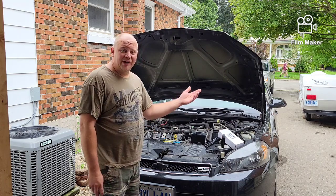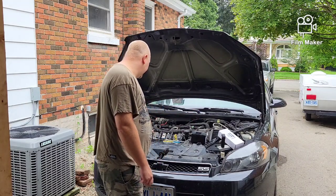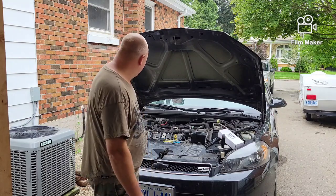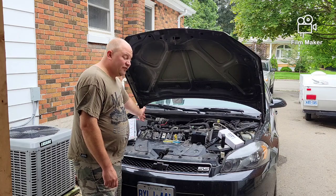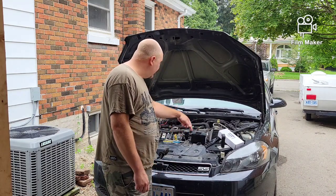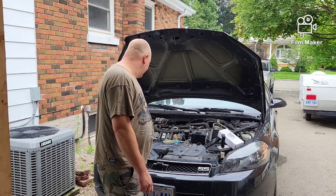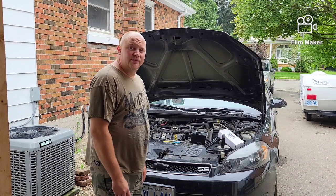Right now I don't really have a plan. I'm going to go grab an 8mm and a 10mm with my screw gun and start pulling stuff off - pretty much everything on top. We've got the coil packs, valve covers, intake manifold. Pretty much everything I need out of the way in order to start getting to the heads. The only other thing is going to be the alternator - just a couple of 15mm bolts and a couple of more difficult nuts to get down on the front between the engine and the strut tower. They make them pretty tight. After that it's quite simple - exhaust crossover, and then the manifolds have to come off to get to the head bolts. The back one's not difficult either - just get back there with an air ratchet and zip the bolts out.